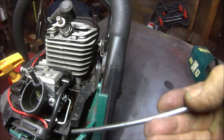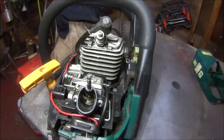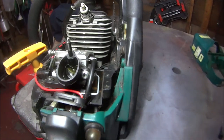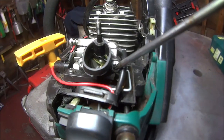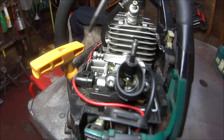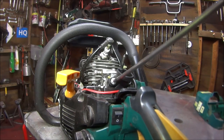It's dirty but I can't really see it properly. So what I'm thinking is I'll remove the carburetor. I'm not sure if I can see that pipe or not. Anyway, let's just remove the carburetor. All it is is three bolts - there's one here, here, and here. I'll just wind them all the way out.